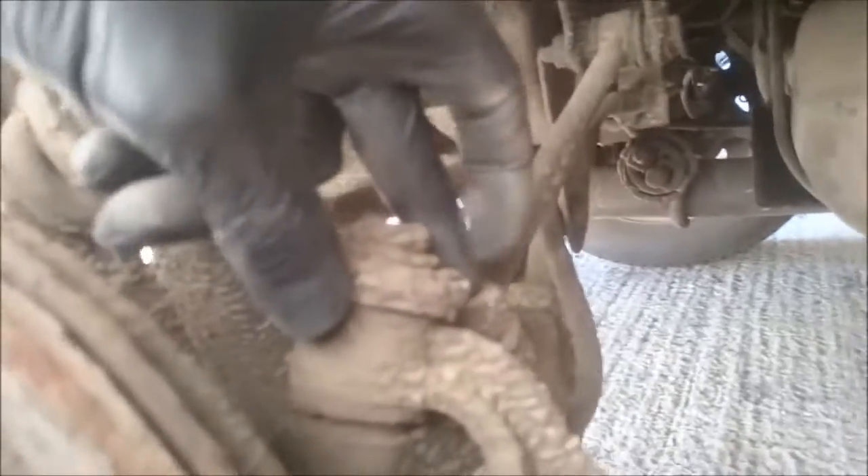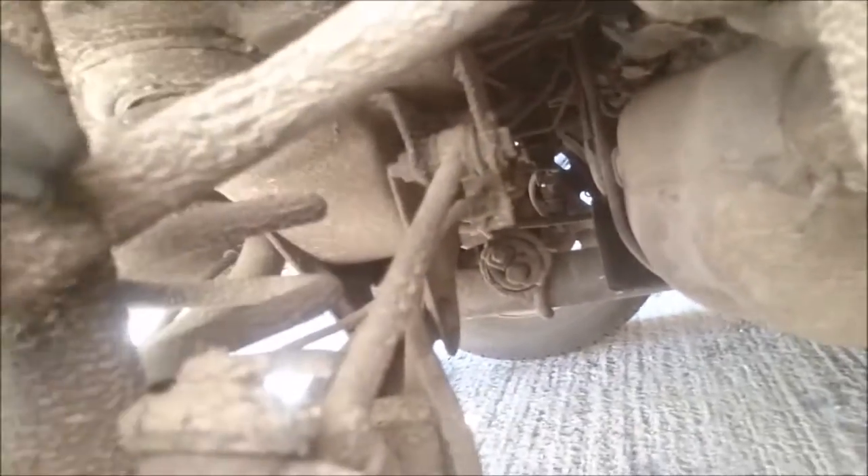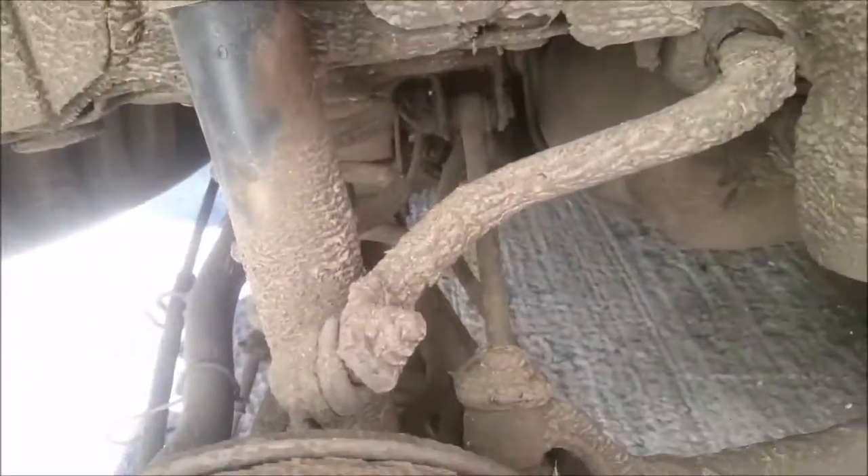This is the bar — there's a tie bar here that goes from the top of the hub up and it's on both sides. They're both knocking profusely, so let's get those sorted. It's a common fault and thankfully these are a lot easier to change from this side. They're about 10 quid a side — cheap and straightforward.